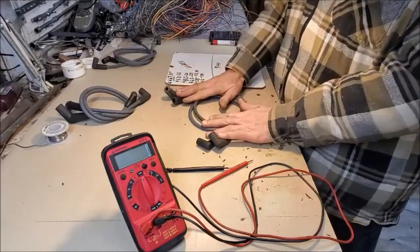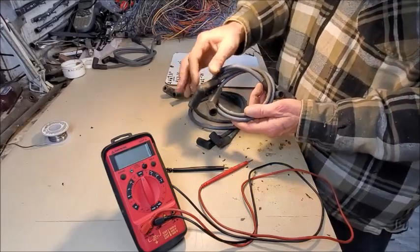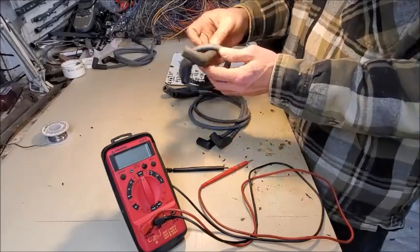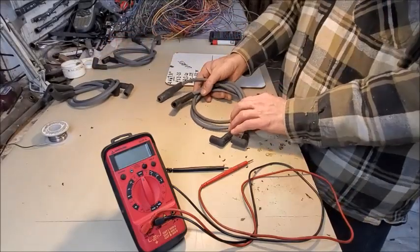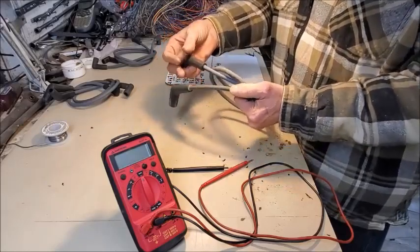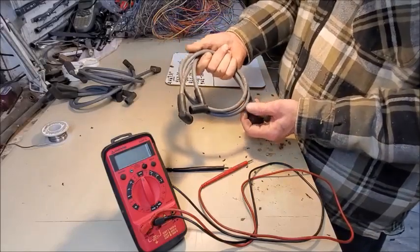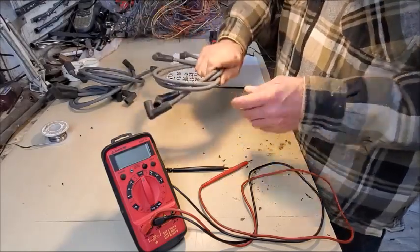Let's first address these three pairs of wires. I have a short matched set — a short wire from the new box of plug wires matched to a short wire that was running on my engine. I have another pair of plug wires — one new out of the box that I will measure the resistance of and compare to the old. And then I have the also important coil wire. They match up in length. I documented the length in inches on all three pairs for the resistance comparison.